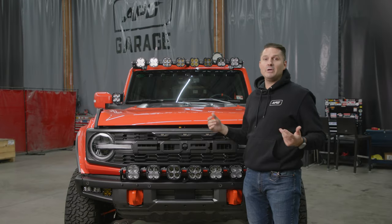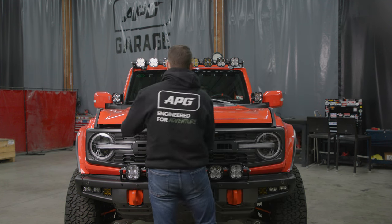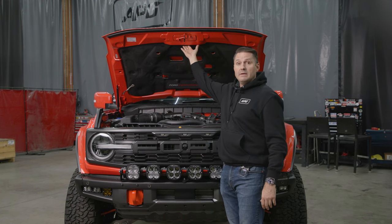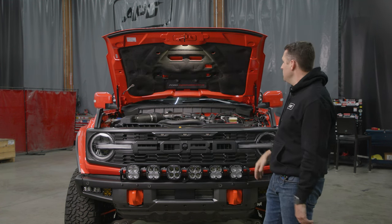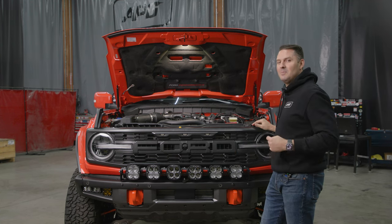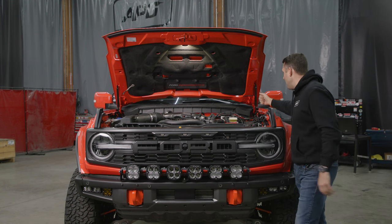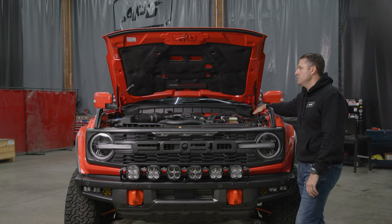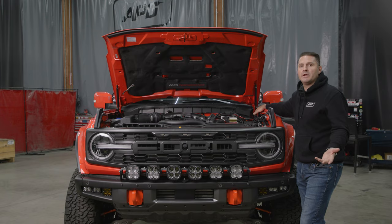For the rare need to pop your hood on a 2023 or newer car, we've got this pretty cool function. We implemented a dome light engine-bay mounted. In order to activate that light, there's a little switch — let's crank it on — and it illuminates your entire engine bay. I can think of a lot of times this would have really helped me. Now let's say you forgot to turn it off and you're shutting your hood — we've got a bypass switch so as the hood closes it's going to shut that off. It's got a bit of a fail-safe so you don't drain your primary battery, since this is hardwired and doesn't need the engine running.